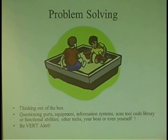So I'm like, well, let me just go in and try to calibrate the steering sensor, which is a common thing. When batteries go dead, disconnecting the battery is nothing. It's dragging the car down to nothing. You don't ever want to do that because you'll be married to all kinds of problems of calibrating stuff, losing memory on certain computers for other features. But I went in to initialize the steering angle sensor to calibrate it, and it didn't work. So I'm like, well, the wiring is good, so it has to be something wrong with the sensor. I'm not going to condemn the computer.